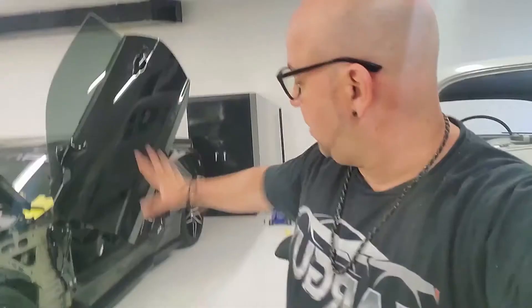That's really the meat and potatoes of how a vertical door install goes. The process is: pull the fenders off, leave the doors on, take the door check out, tape the door in place, remove the factory hinges, disconnect or move your door boot and harness, bolt in the new kit with settings preset, mount it leaving the shock dangling from the top bolt only, have somebody lift the door so the bottom of the shock lines up, plunge it into position, and put in the lock pin.